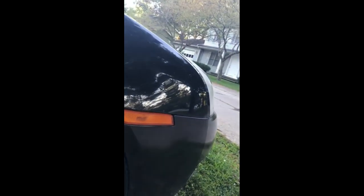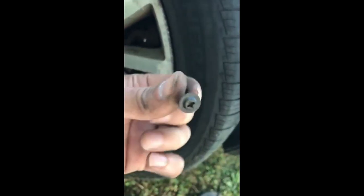Hello YouTube. This is a 2009 vehicle and I'm trying to replace the passenger side headlight. What you have to do is go through the wheel well and extract a really long Phillips screw — take your time, it's a pain. Pull this little cover off — there's just one screw on top — and that exposes a hole. You'll definitely see the headlight right there. It's about less than a minute job.